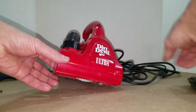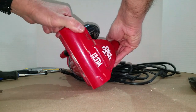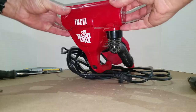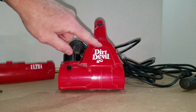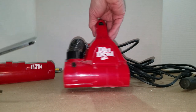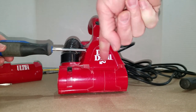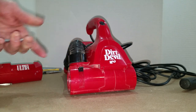The first thing to do to get the belt off is to take this front flap off — the thing that you rotate to switch between the brush roll and the hose for vacuuming. To do that, just pull out on the sides and pull forward and it will pop right off. Now the front piece that says Dirt Devil — that's a little cover that has to come off. To get it off there's a Phillips head screw inside the hole over by the hose. I use a magnetic tip screwdriver so that the screw will come out with the screwdriver.